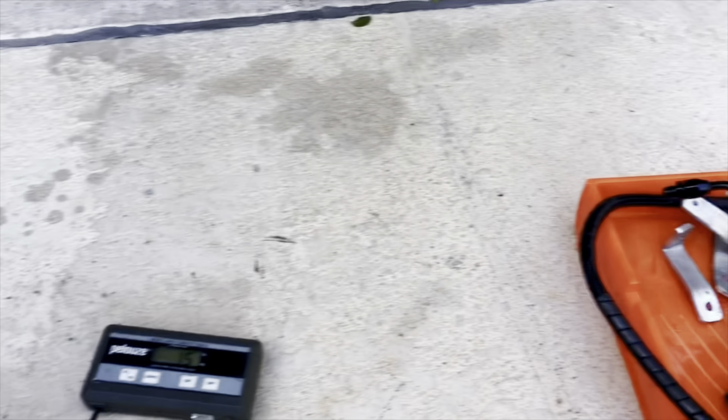This is the left and the right. We have the pressure side, the suction side, and that's basically it — all cleaned up and ready to go. This is the pinion shaft. I just welded it up because there was movement — it would bottom out on either side, so as you turned it, it would actually have a little flex to it. This is part of the internal valving, and there's an outer valving that goes with this, along with ball bearings. I'm going to put this back in — it goes on like that.